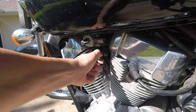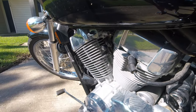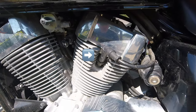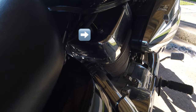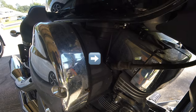Ensure you use your choke. We also changed out all four spark plugs. Make sure you have the special size tool — we learned the hard way that it's an 18-millimeter spark plug wrench for Honda. You can buy the spark plugs at your local AutoZone, or I got mine at O'Reilly's. I am not sponsored.